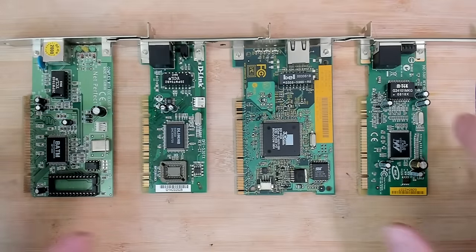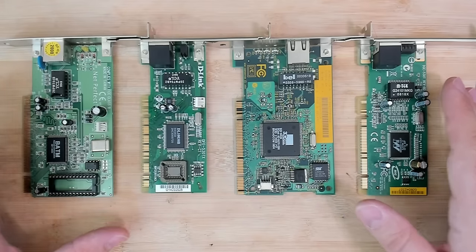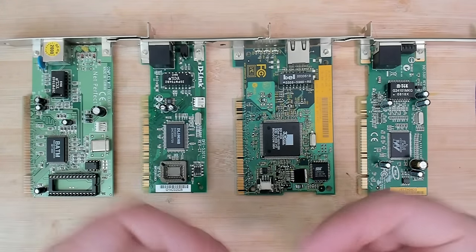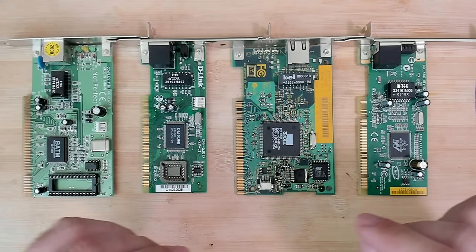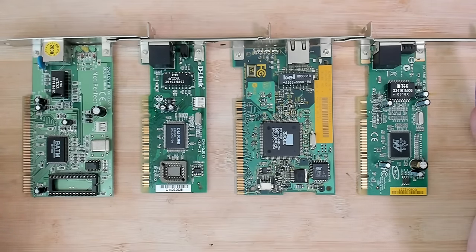So today we are going to figure out how this technology works, we will set up a test system, and then we will dig a little bit deeper to figure out how this technology in its core works. And then we will come across a term called magic packet, which we are going to dissect and try to build one on our own and send it across the network.